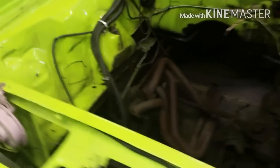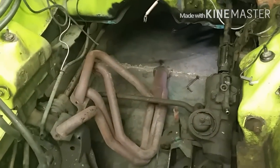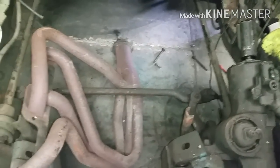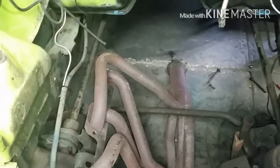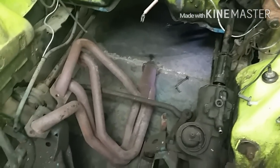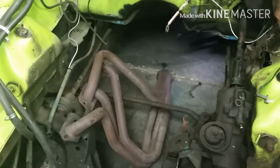Skipping ahead — it's out of there. Yeah, that's a big old gaping hole. All I gotta do now is figure out how to get the header out of there. It appears that to put headers on this car, you have to disassemble your steering linkage. I'm not a fan of headers at all — they leak, they rust. Sure they sound good, but is it really worth it for that 20% horsepower gain? Anyways guys, motor's out, tranny's out, driveshaft and so on.